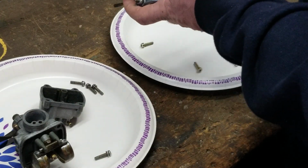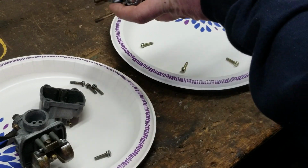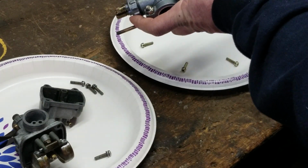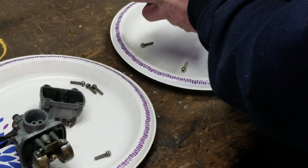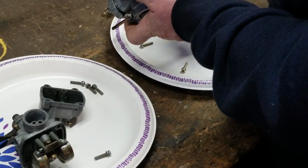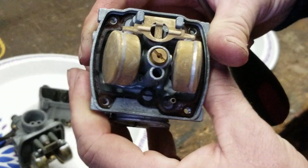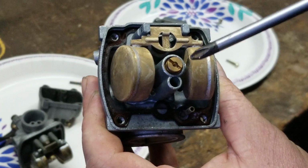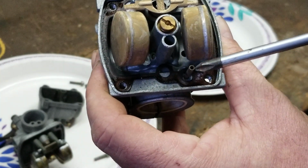A lot of people looking at my videos go, well, that should be about the same. Well, yes and no. There's some variables, there's some differences, that sort of thing. Alright, so now in comparison, you have the same thing. Your main jet here, your pilot jet here, and your choke pickup right there.